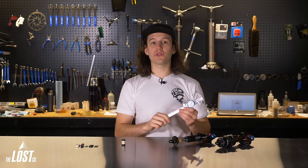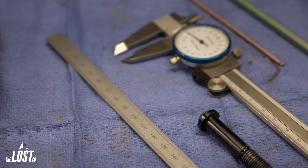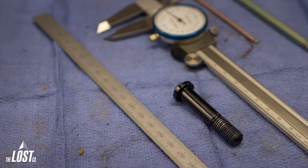If they don't know, there's method number two: measure your mounting hardware yourself. Grab some calipers or a fine ruler with millimeters and either measure your current shock's installed mounting hardware or the frame and bolt. Measure the internal diameter of the hole where the bolt goes through, then measure how wide the mounting hardware is from side to side.